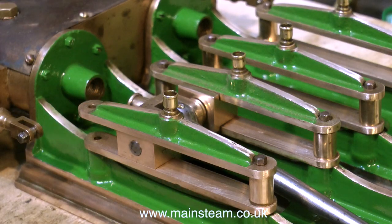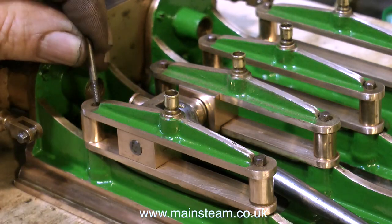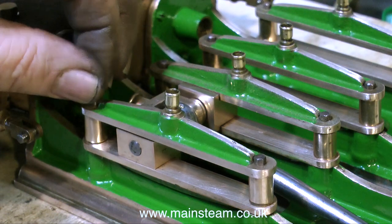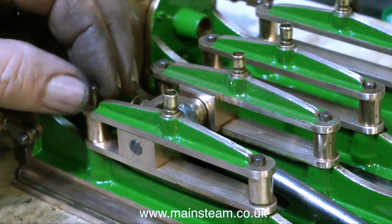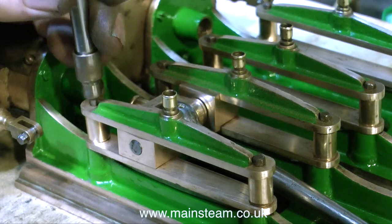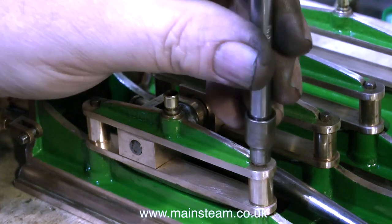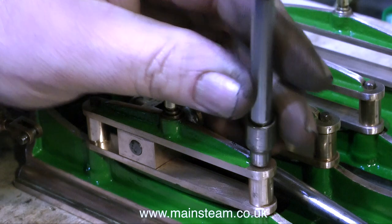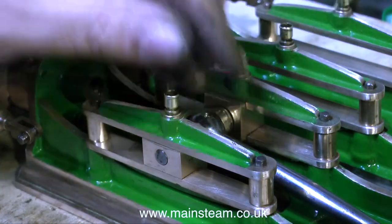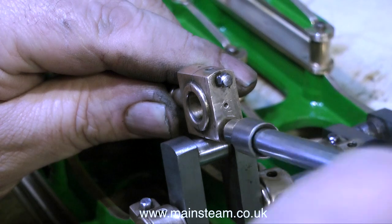I've mentioned before that with this engine, surprisingly, none of the bolts encountered so far have been sheared, and as I get to the end of the rebuild it's looking like none of them are sheared — congratulations to the builder and to anyone who's worked on the engine in the past. It is really easy to snap these bolts if you put too much pressure on them. I'm using just a screwdriver handle style driver for the socket, and even with this I could shear the bolts, so if you're doing a job like this be very, very careful. If it's a bigger engine with quarter inch bolts you can still shear those, but you'd need to be really ham-fisted to do that.